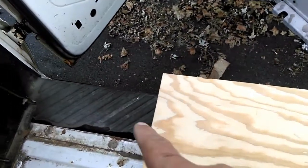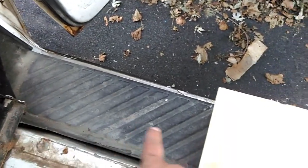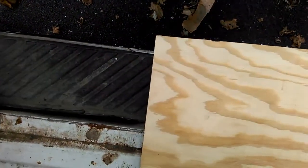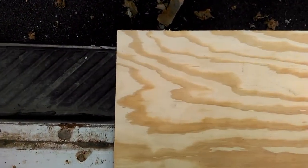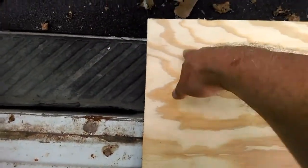And I don't need to cut out for this stair step, because I'm just gonna be covering that over with more plywood. I'll have to support it from underneath — build some kind of a little framework out of two by fours to support that floor so it's not all floppy like that. But hey, not too bad.